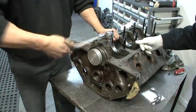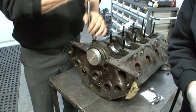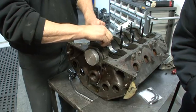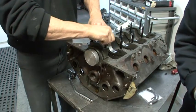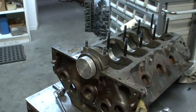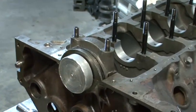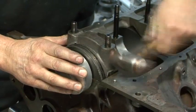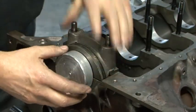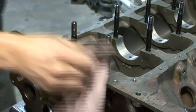Shane's crushed the seal in place with our little mandrel adapter. You won't have a mandrel adapter, so you'll be putting the crank in and doing the same thing just to crush the seal down and position it. You don't have to tension it with a torque wrench — just do it up nice and firmly. Sometimes the seal won't go down, which means you've got to repeat this process a number of times. Otherwise your seal's going to leak.